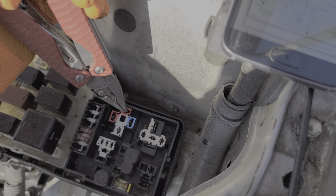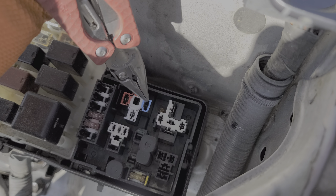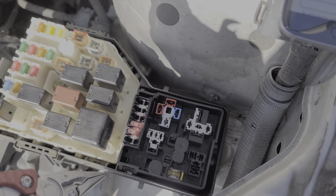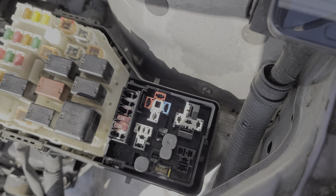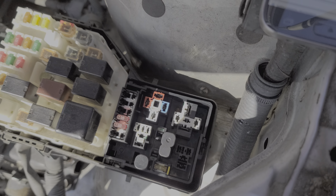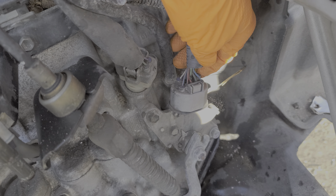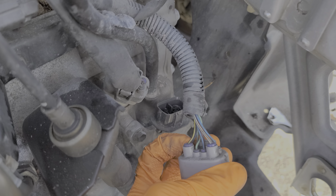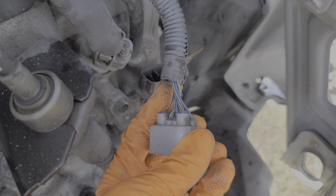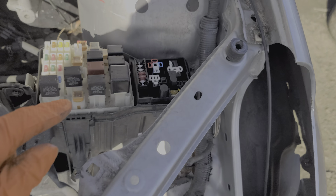This relay receives power on those pins and it receives a ground on this pin. That ground can come from one of two places. If you've got an automatic transmission RAV4, the ground will come from your neutral safety switch when you are in park or in neutral. If you've got a manual transmission RAV4, this will come from the clutch safety switch — it only provides a ground when you're pushing the clutch in. Since this is an automatic, I can show you where that neutral safety switch is. This is the sensor that detects whether or not you're in park or neutral, and the RAV4 won't let you start the vehicle unless you're in park or neutral. The way it does that is it connects the black-yellow wire to the white-black wire when you are in park or neutral, which sends ground to the relay.